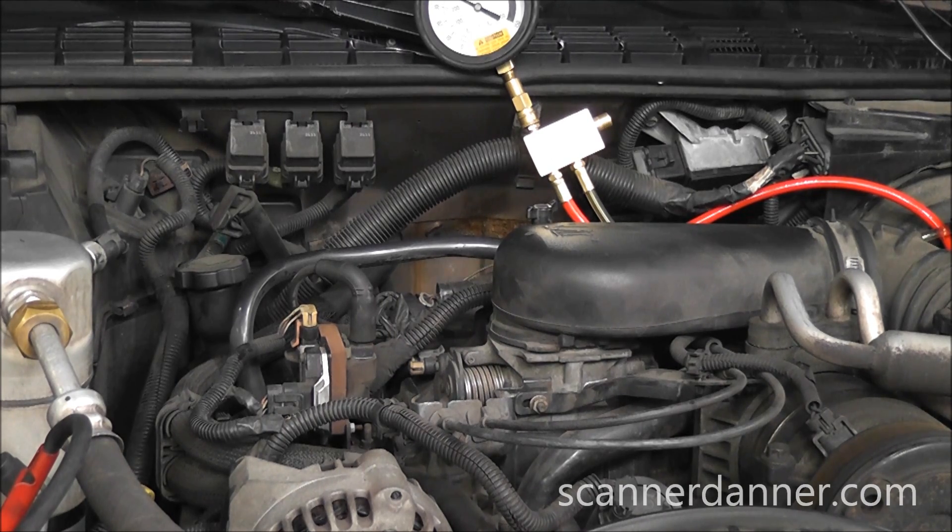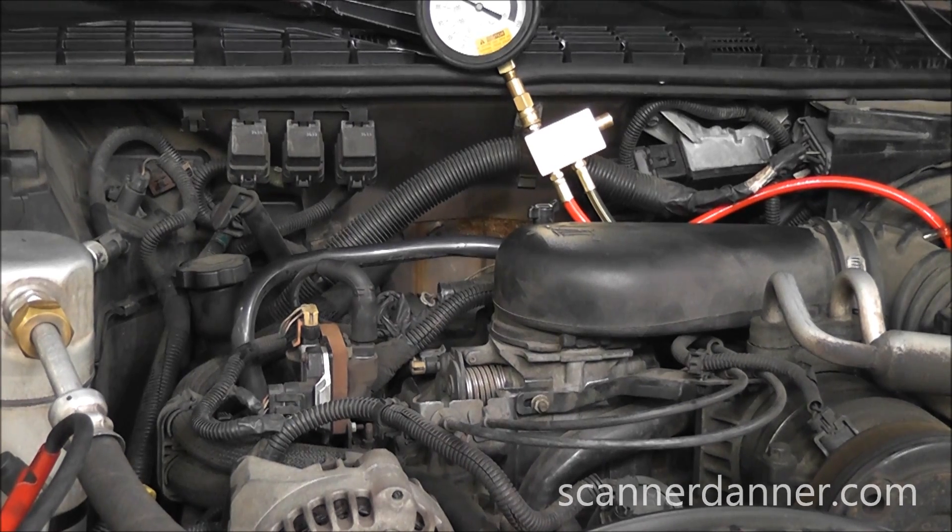You can have the electrical injectors firing all day long, but they're not spraying fuel until you hit 50 pounds of pressure on this vehicle. So what happens in this case — two things I'm going to hope I can show you — is one, when we put propane in it the vehicle starts on propane, then charging system voltage gets higher and now we're putting two, three, four volts higher than cranking at the fuel pump, and that's going to give it enough to bring the pressure above 50 and have the vehicle run. So we'll attempt to do that first.